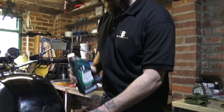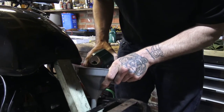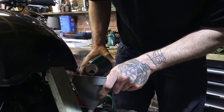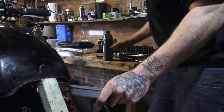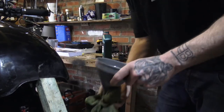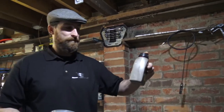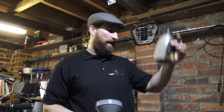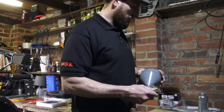So I don't get the brake fluid all over the paintwork and all over the customer's motorcycle, I'm going to use this funnel to gently feed the new brake fluid in. Do it gently and slowly. The idea is it's without air. If you start taking a bottle of brake fluid and start shaking it, it's going to take a few days before that air dissipates out and it'll be useless. So we'll put that out of the way so we don't confuse it.